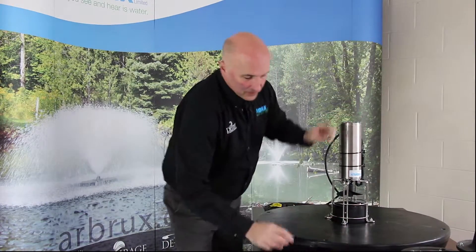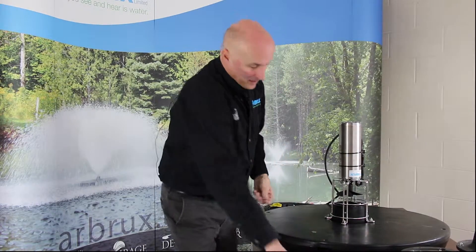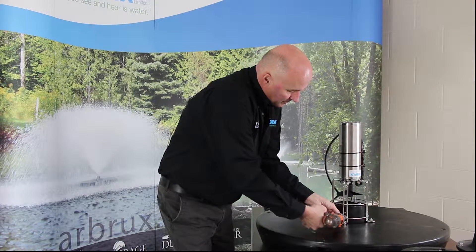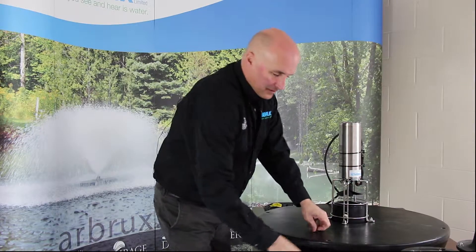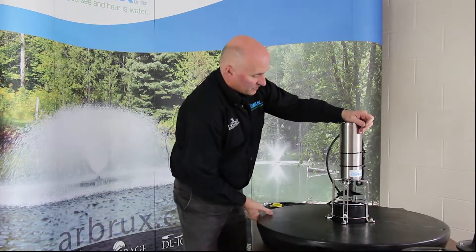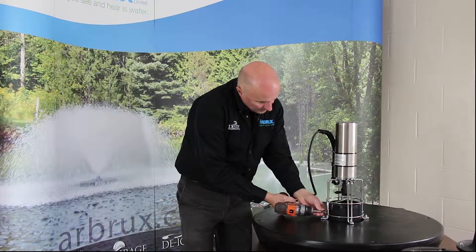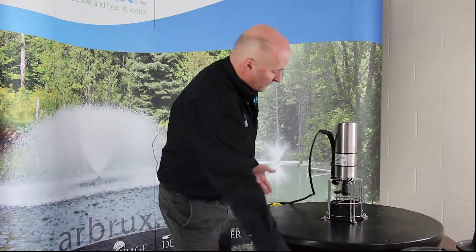There's going to be a little screw hole here where an 8-32 screw goes in. Don't over-tighten them — you're tightening into plastic, but you will compress the washer, so don't be worried about that. Just run it in and you have a nice tight fit. It goes up against this steel ring here, which prevents the water flow from pushing the spray pattern deflector arrangement out. Then one on the opposite side, 180 degrees over.